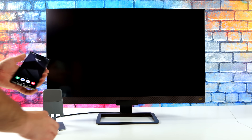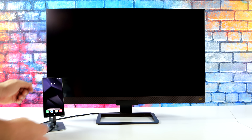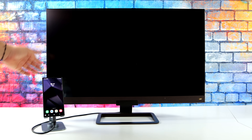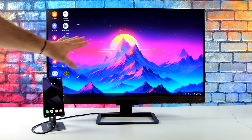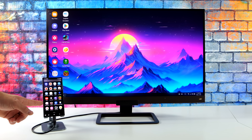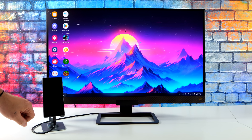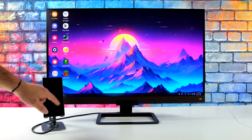Getting this setup is super easy. Basically, what we want to do is go ahead and plug this into our display. You can use the adapter if you want to, but the monitor I have here does have USB Type-C video in. It'll do up to 4K 60 Hertz. And out of the box, the Galaxy devices, at least the new ones, are set up to automatically use DeX once HDMI is detected. And as you can see on the big screen, we've got a desktop interface, and over here we can actually still use our phone. If you don't have a mouse and keyboard, that's fine because there is a built-in digital trackpad. Down in the lower left-hand corner of your phone screen, you will see the icon once you have everything connected.